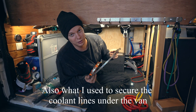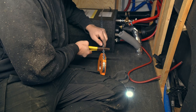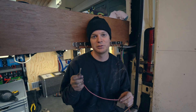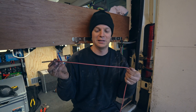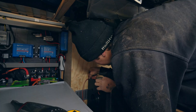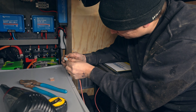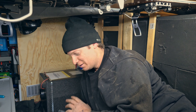This is what we're using to mount the hot water unit and fix it to the floor — you can buy it at any hardware store. It's a steel builder's bracket with holes all in it so you can put screws anywhere. We'll cut off two lengths and strap it down to the floor. This is our temperature sensor for the hot water — there's a 6mm hole welded in the side and it just slides straight in. It's got silicone on the outside so it won't melt with the hot temperature. That'll tell us our hot water temperature on the screen on our Simmarine, using the cable from the Simmarine connected with Wago connectors, zip-tied across the top of the heater.